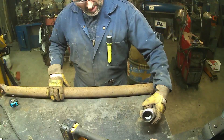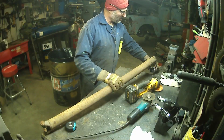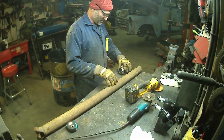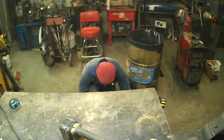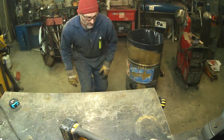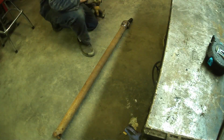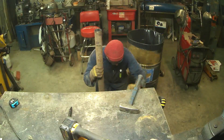Usually I do this on the floor but I'll see if I can do this up here. I used to phase my yokes down so they stay phased right, so that way when I'm smashing her in they're aligned. I'm going to have to redo this on the floor so you can see better what's going on. This one doesn't exactly line up great. I kind of get them phased and then I'll make a mark on it so I can take it off the line. You're going to have to smash her down pretty good to get her in place.